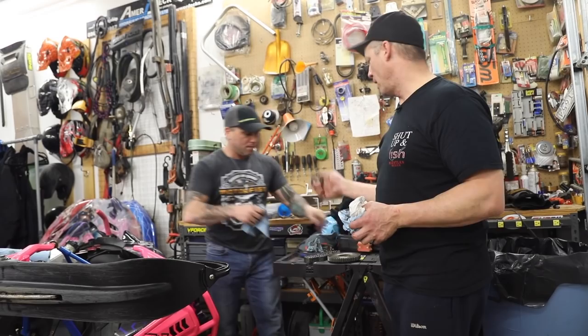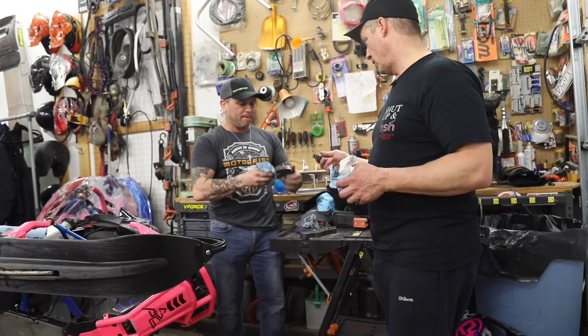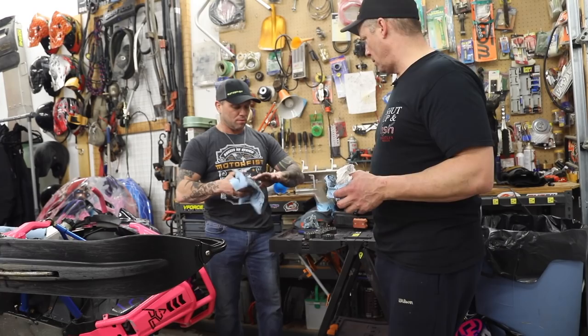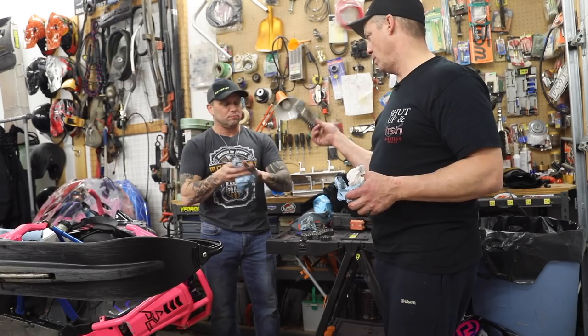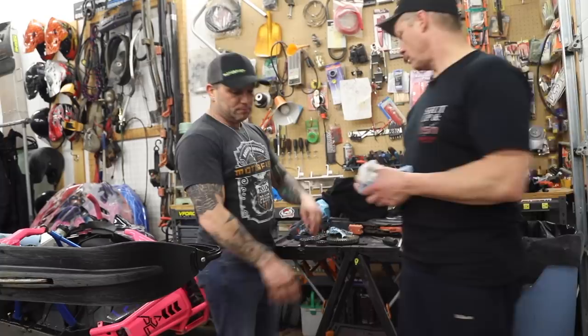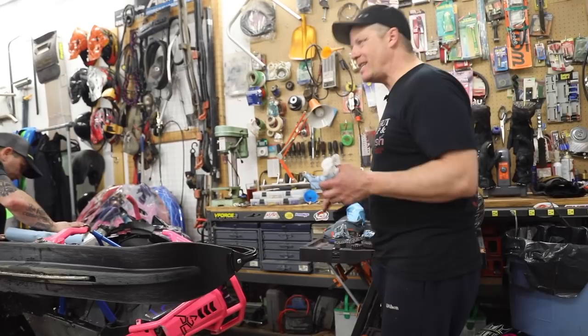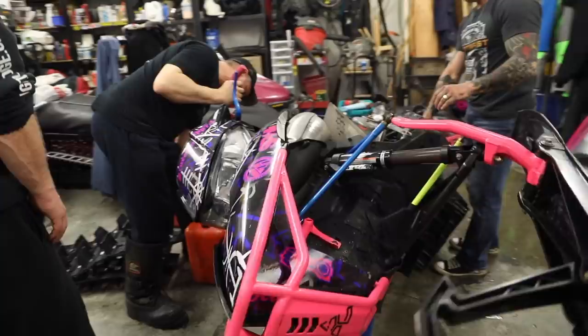The rule of thumb back in the day was don't go smaller than 19 if you don't have to — go up in that size. If you go up in size you're going to get more torque, but then you have to change the chain. If you go to a bigger bottom sprocket there's way more money because the sprocket costs more and you've got to buy a chain. Another problem is the bottom of the chain case usually can't handle a bigger chain or bigger sprocket. I like the way cats are geared — 19/50 is nice and low. That's why they're not super fast, but they actually work really good. The clutching's right on the money and they don't blow belts.